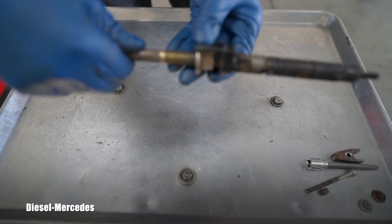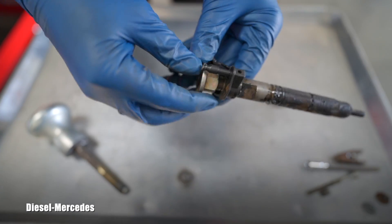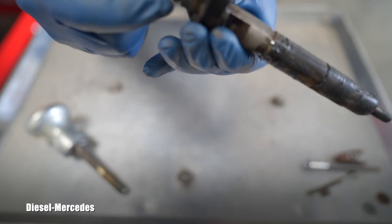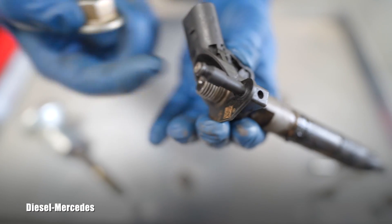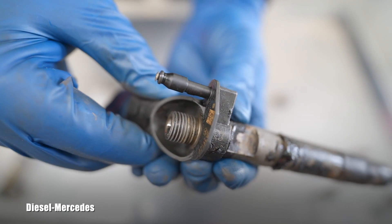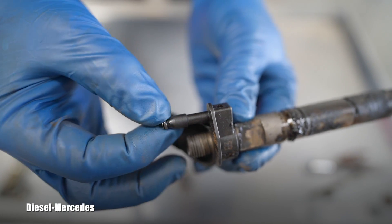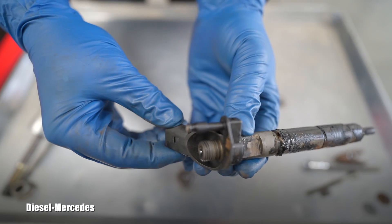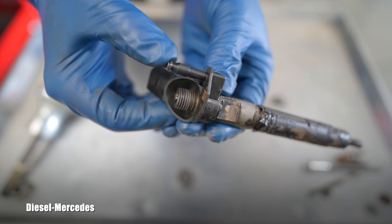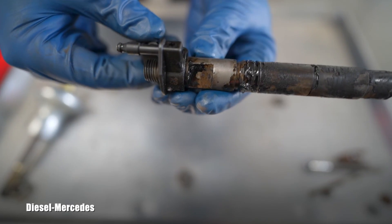Here in detail - this is how it came out, and here is that homemade puller. This is the attachment to the injector through the nut. I'm really worried about damaging those threads so you have to be careful. Now - the return line miniature O-ring: comparing with the other ones, it's swollen, way bigger in size. I immediately went and ordered a new set, so that will be replaced. I can confirm I didn't damage anything.